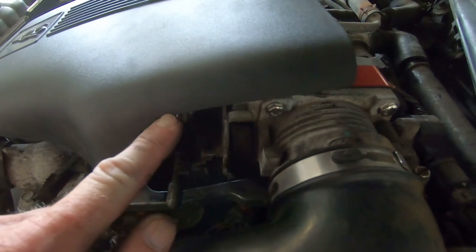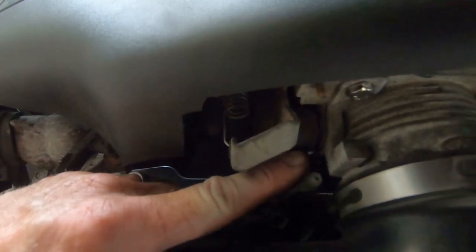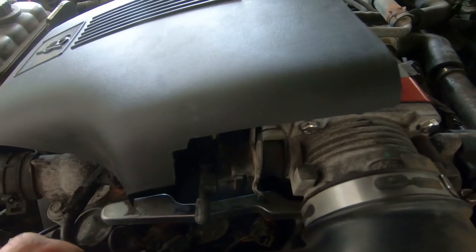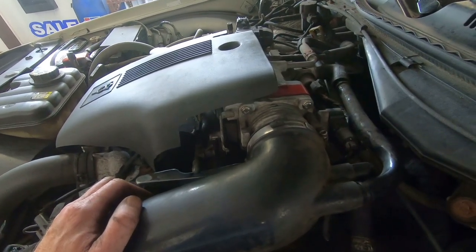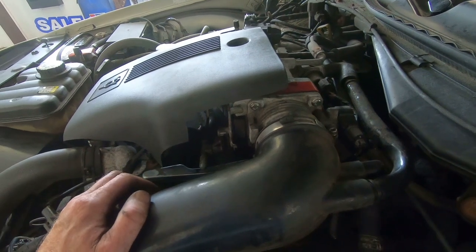We got this trimmed out a little bit higher and stepped down so that the throttle can come out to full and not hit the plastic — obviously we moved everything back about an inch. That's how you install a throttle plate spacer on a Crown Vic or a 4.6. The model number I used — bought it on eBay — was 48948, and I'll leave the link in the description box below. You'll need a 5/16 and a 10mm, and all the other tools come with it. Depending on your application you may have to do a little bit of trimming on that cover.